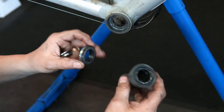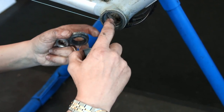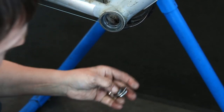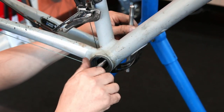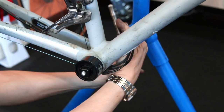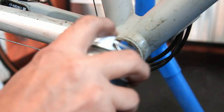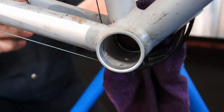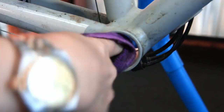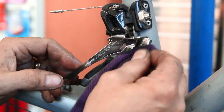The bearing came out of one side but left the cup inside the bottom bracket shell, so I extracted the other side first, then used a slightly bigger fitting on the cup and extracted that out. No hammers involved — it just smoothly draws them out without any deforming of the shell itself, and once that's all cleaned up it's absolutely spot on.